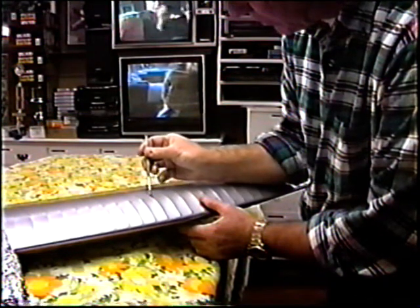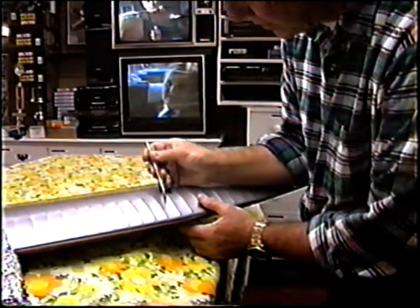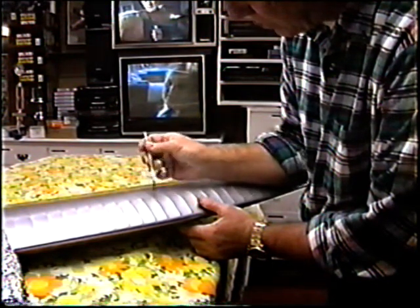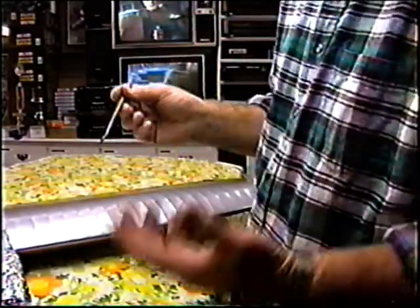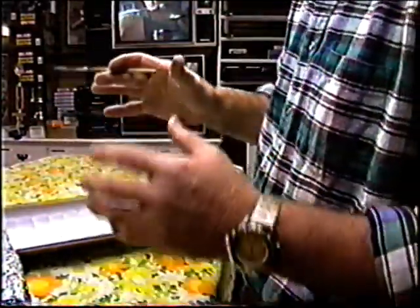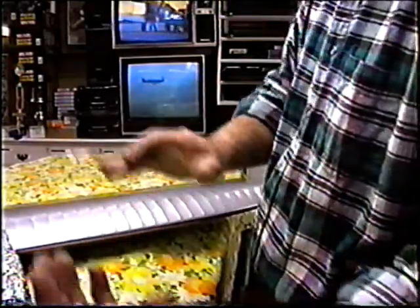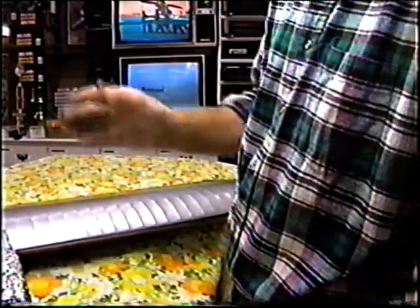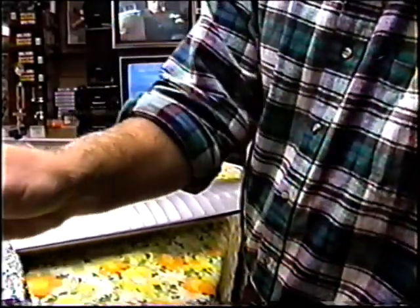Also, another thing, when you're doing this kind of work, you almost have to be under fluorescent lighting. Having incandescent lighting will mask all the flaws. You want to be under fluorescent lights. Fluorescent lights and silver show flaws like a magnifying glass. And that's what allows you to take and make these little corrections, so when you take it out in the sun, it just looks perfect. Or it looks better than any other way I know of to make it.